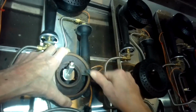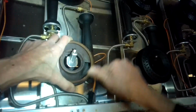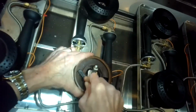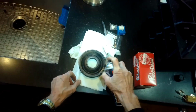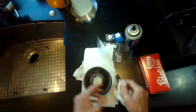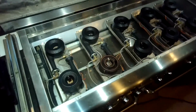Turned out with this particular one that these steps didn't help. This often does work. You should try this first. But in our case, the spark module that creates the spark was just worn out. It was just used so often that it needed to be replaced. In some ovens or some ranges, they have one spark module that brings spark to all the different burners. But in this one, each burner has its own little spark module. We'll put a link in the description below if you need to get a spark module for your Capitol range too.